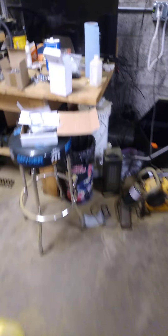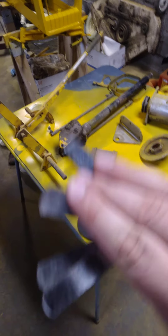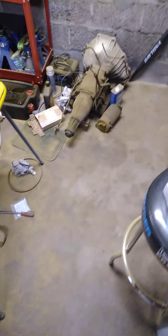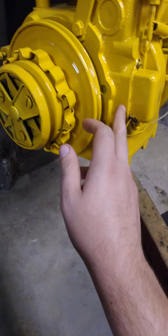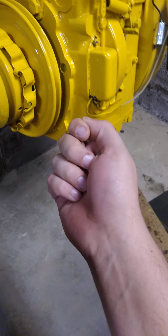For people that don't know what a feeler gauge is — this is a feeler gauge. You pop it open and these are all your different gauges; as you can see, it says 24 thousandths of an inch and so on. Get your feeler gauge, open the points up to their widest part, and put your feeler gauge in there. These are supposed to be set to 20 thousandths of an inch. Select a 20-thousandths blade, put it in until there's a slight resistance, tighten that up, pull it out, rotate a couple times. It rides on a little rod by the cam — that's what triggers your ignition. Do it a few times, put your feeler gauge back in, and it should be good to go.